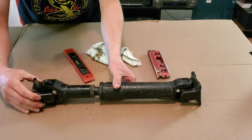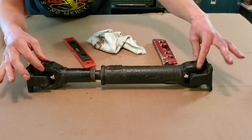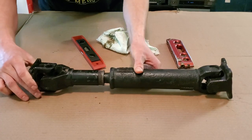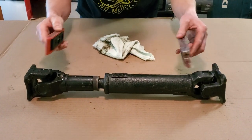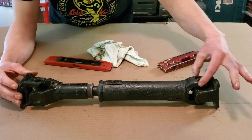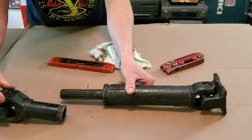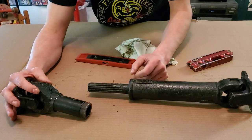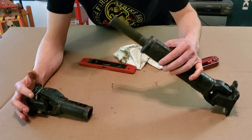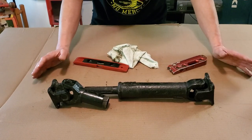You're not lining up the ear of the flange — this is a flange, this is the actual drive shaft slip yoke. So these are the two ears you want lined up. Even though the flange ears might still look level, it's incorrect because this is the flange part and this is the actual shaft. Make sure you've got the ear of the actual slip yoke and the actual drive shaft lined up. Ideally, just search for those dots, hammer her in, and you're good to go.